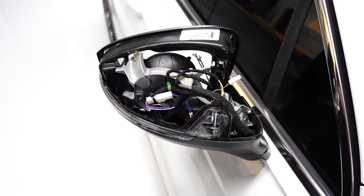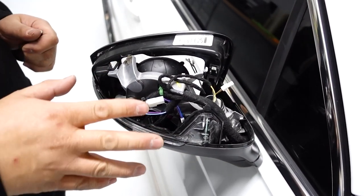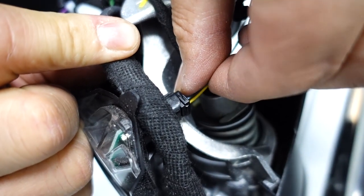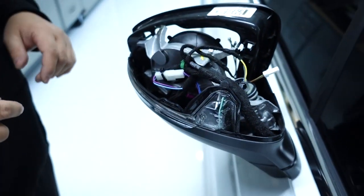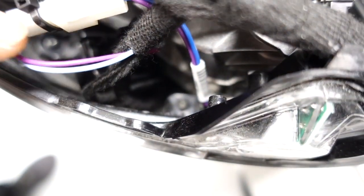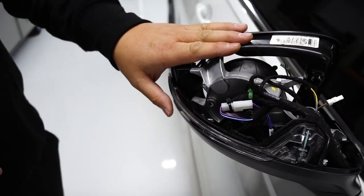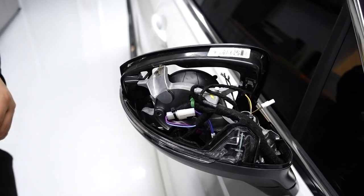After you're done with the blind spot indicator on the mirror cap, go back to the housing. There are a few things to do in order to swap this out. First, disconnect it — here's a harness, and on the inside facing outwards there's a little tab. Just give it a push and pull out. Next, there could be two T10 screws holding this indicator lamp in. One is exposed right here — the inner one — and the outer one is actually hidden below this cowl. You're going to have to unscrew the two bottom T10s in order to remove the cowl and access that hidden screw to fully remove the turn signal.